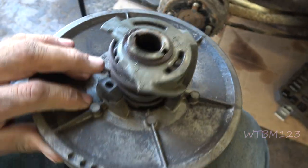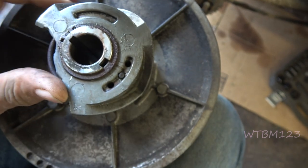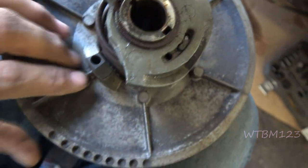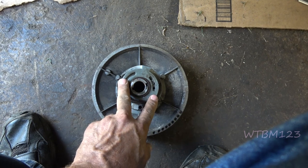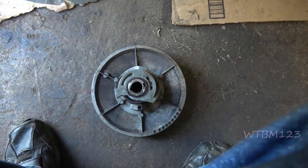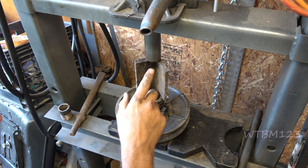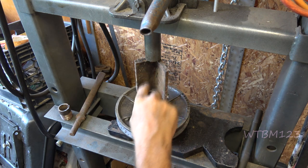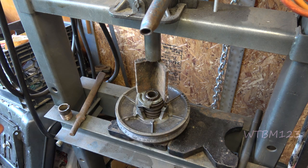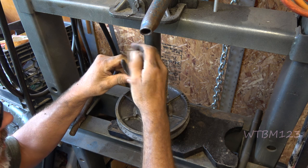So here's what I got — one piece is broke off there. I guess what I need to do is compress this, get this C-clip off of here, and see if there's play in the rest of this clutch. Now I want to keep note that this spring is clocked in the center hole. I'm going to go back to the press and rig something up — probably dangerous — to push down a little bit on that and get that C-clip out. What I've done is taken it to the press with a piece of angle iron. If this angle iron was more square it would be better, but you're just putting enough pressure down to try to get this C-clip out. Once you get the pressure off you can stop — there's not that much pressure — so I'm not too worried about it. Do whatever you want to do to feel safe.